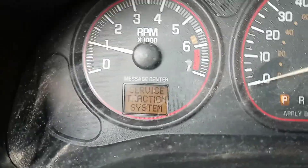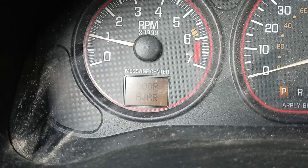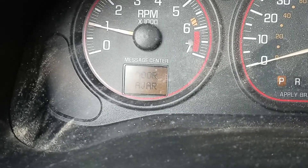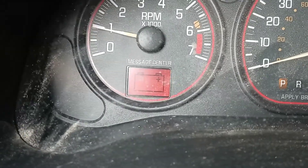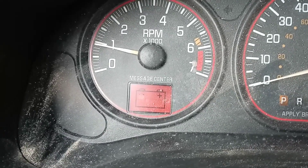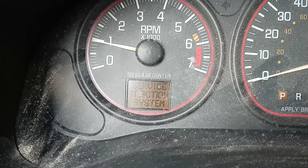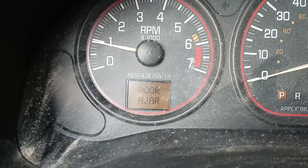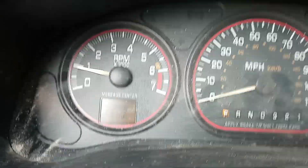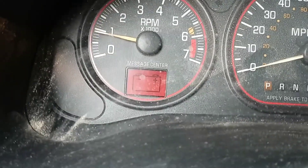It's done in reverence to the battery — it's got a new alternator, the battery tested good at O'Reilly's. It's a brand new alternator and it's still showing the battery light. I charged the battery up at O'Reilly's yesterday, put the alternator on again, and something's not working right. It's a brand new starter, brand new alternator, the battery's as good as new, and the battery light's coming on again.